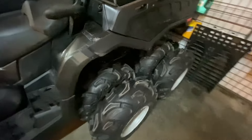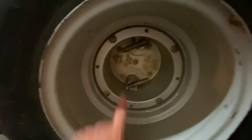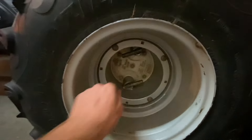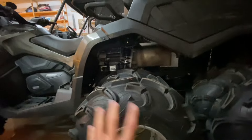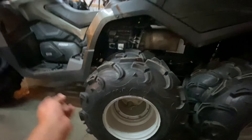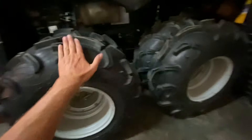So this is how these duals work that were on this quad — these are the original ones. These are the click dual ones. You just crank these two dials and then you give the wheel a half turn the wrong way — the way that it drives. You kick this wheel that way because it clicks in, give this wheel a click, kick it that way. Drive it up on a log, kick it off, and these come off.